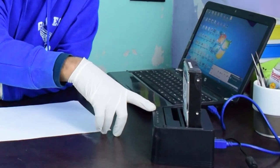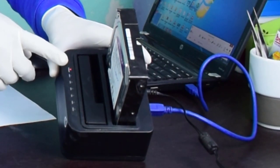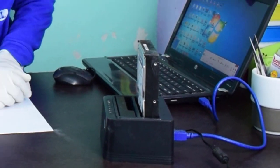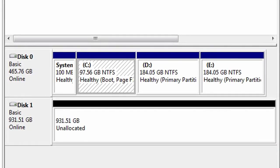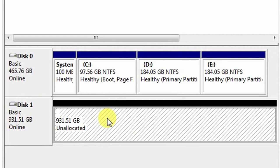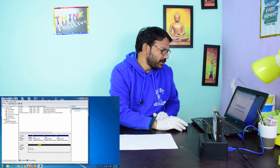Wow! You can see the red LED bulb is glowing, and the white LED bulb is also glowing — it means the hard drive has started being detected. Checking disk management, yes — it is Disk 1, showing 931.5 GB. It means the one terabyte hard drive is now detected in the laptop, showing as unallocated space.